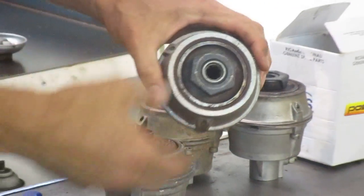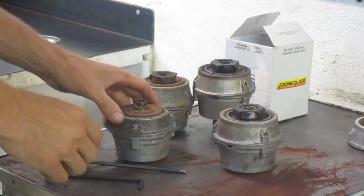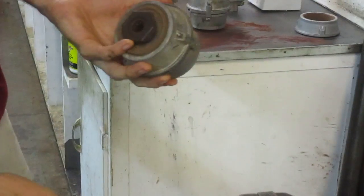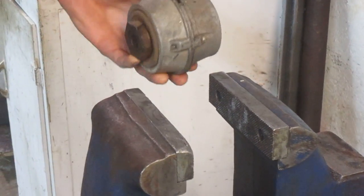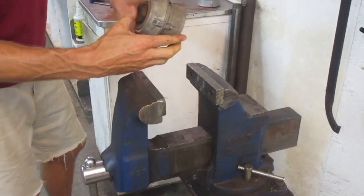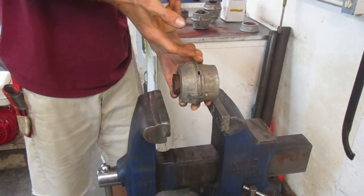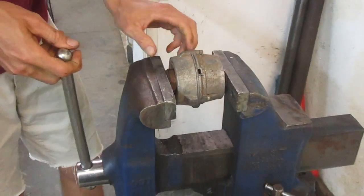Several of the components in these clutches are the same — they take the same bearings and the same inner spring, but the actual clutch linings are different. The disassembly procedure is relatively the same. What I'm going to do first is put it in a vise. Having a vise that opens to seven or eight inches is a good idea. The idea is to compress the inside cone of the clutch, mimicking the same action that happens when you squeeze the clutch lever on your handlebars.